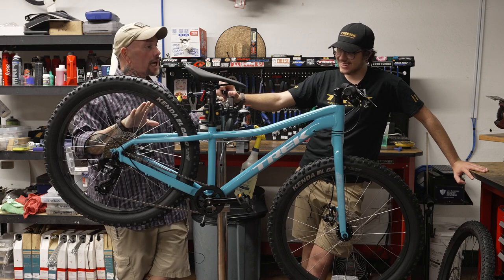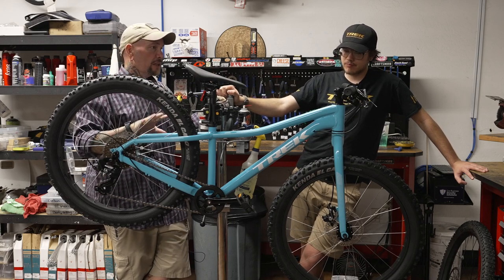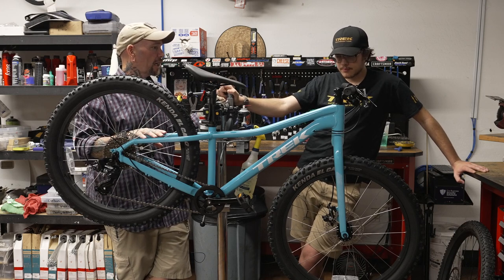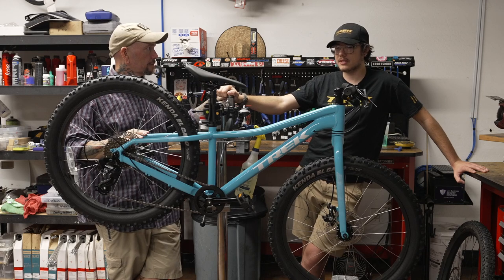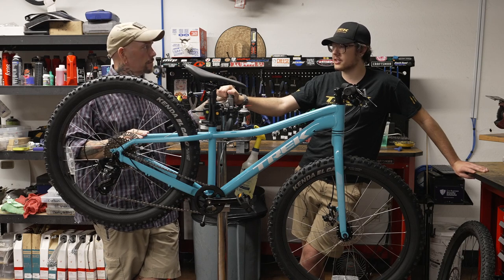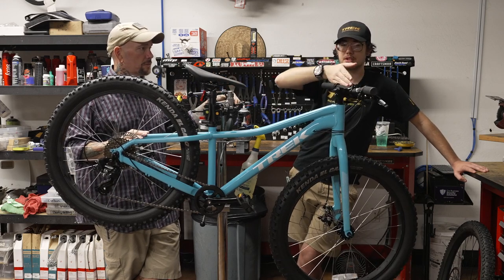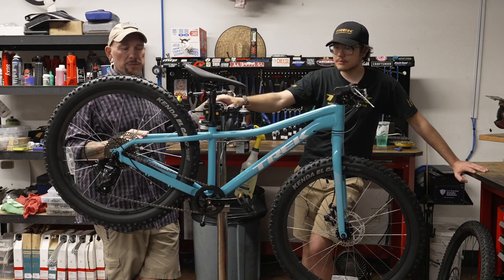I find it interesting going with mechanical brakes to keep the price point down, but for the kids it seems like they'd have an easier time engaging a hydraulic disc brake. Is there adequate stopping power here? That's actually a common misconception — you can get a mechanical disc brake feeling just as good as a hydraulic disc brake, you just have to adjust it correctly. Hydraulics stay adjusted longer due to cable stretch, but kids will easily grip this. You can dial those levers in just like a hydraulic brake — if your kid has smaller fingers and can't reach quite as far, you can bring that in.